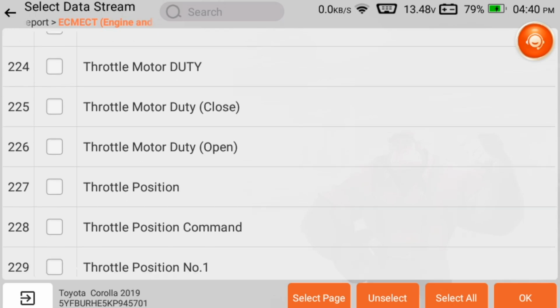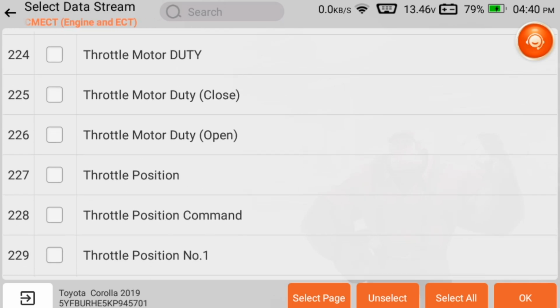Nope, nothing there. I've already looked at this, but what I'm not finding is the AC pressure, which is normally your high side pressure, system pressure. It's not giving me that information, which is a very important sensor to know if it's skewed or not. The evaporator thermistor is another very important one. And as of right now, these are not showing up on this scan tool.